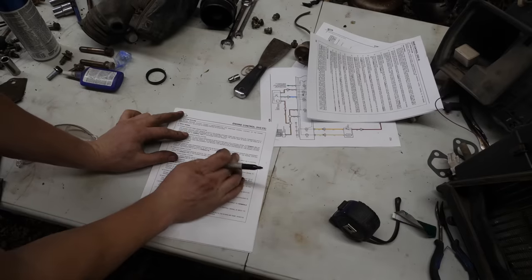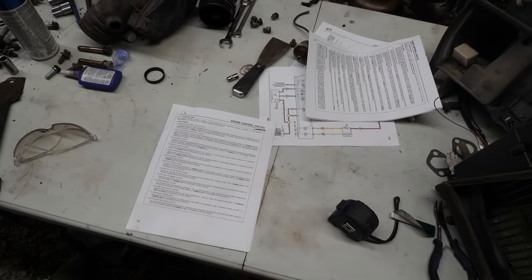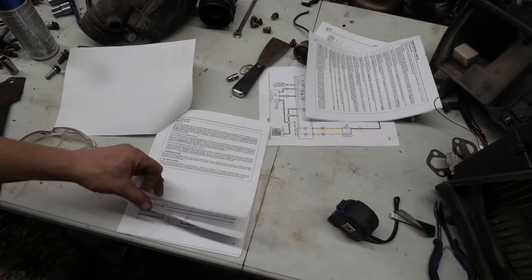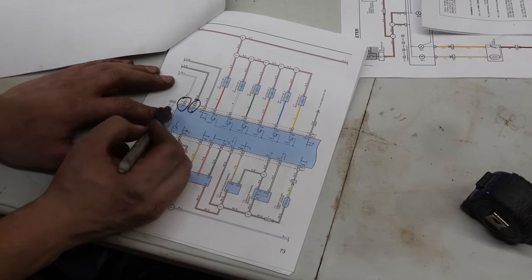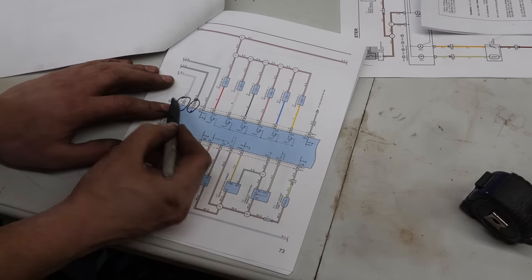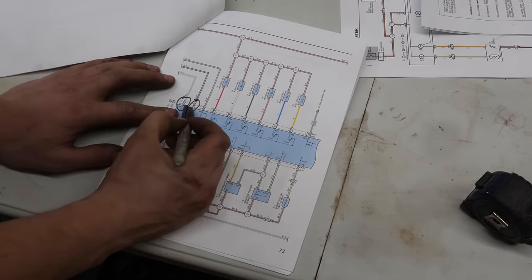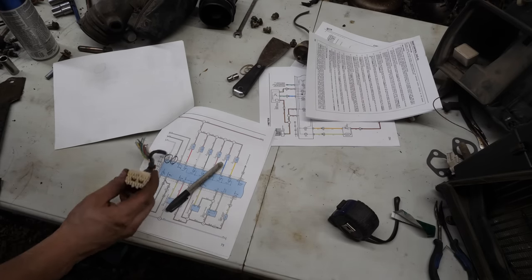So this diagram right here is the engine control diagram for the 3.4. And if we go through, we can see where I have already marked what we're going to need to tie into. So for example, right here, right off the bat, we have this B+. B+ just means that it wants a switched power. And there's also a BATT, B-A-T-T, which just means that this is a constant power. And if you look, it is in plug D, which is this very last plug in the ECM.